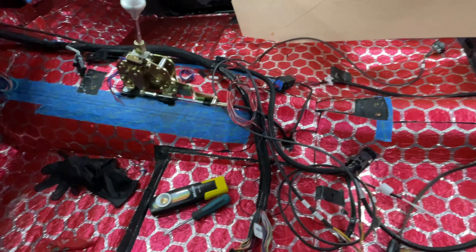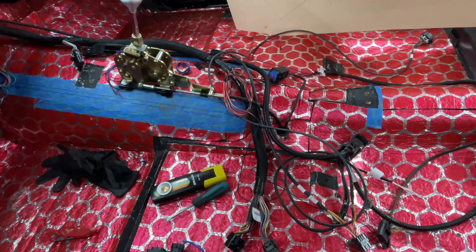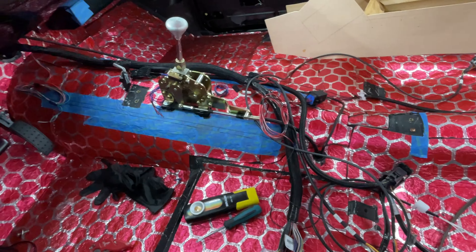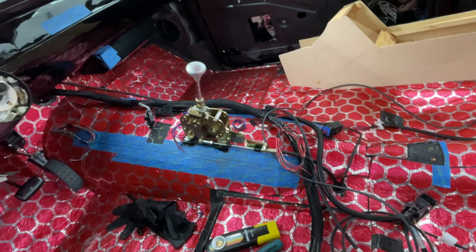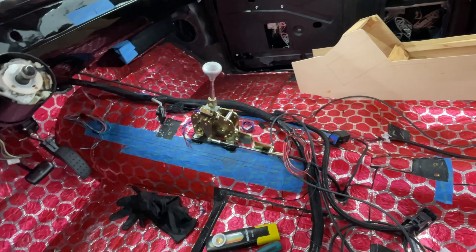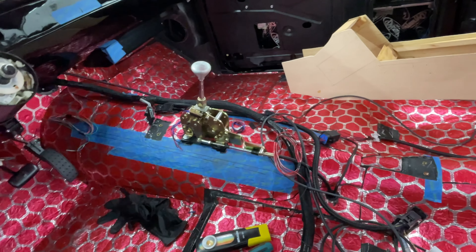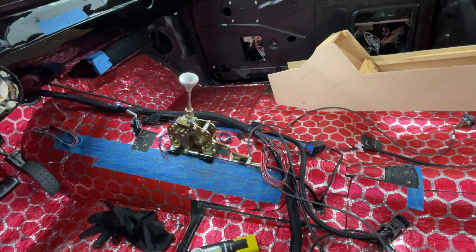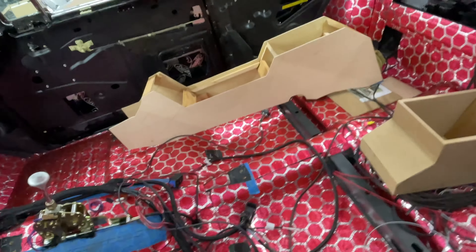The shifter needed to go in and the shifter cable took a little bit of messing around to get adjusted right, but now I know where all of that is going to route. I'm going to put some clips underneath because the transmission tunnel and console will get cluttered quickly, so I want to keep that tidy. I'll likely have to run another fuse block to do a switched relay for some of the additional accessories I'll need, but that's TBD.